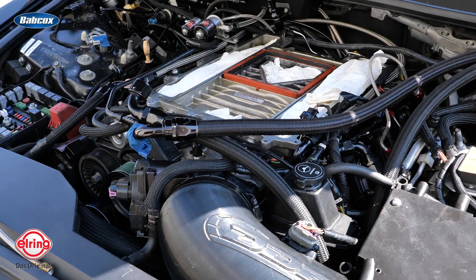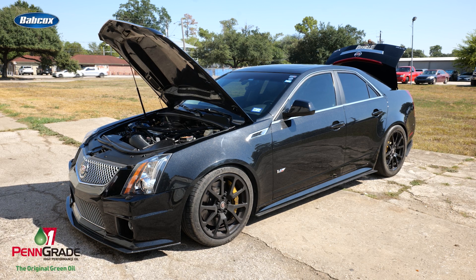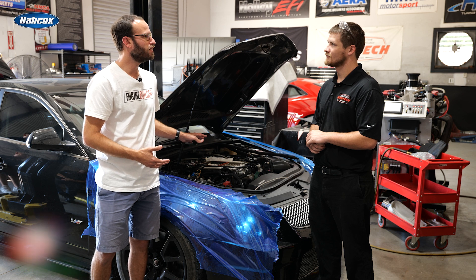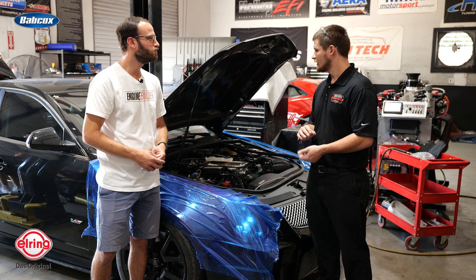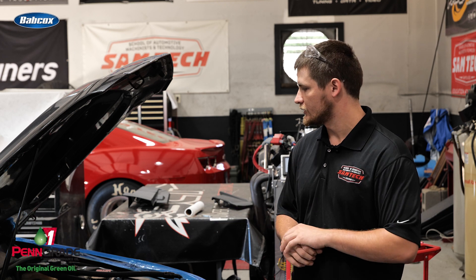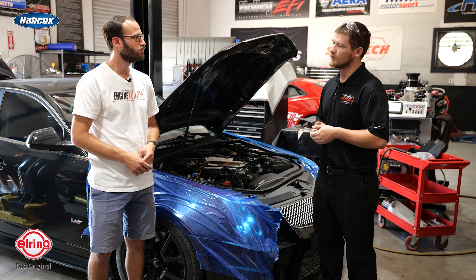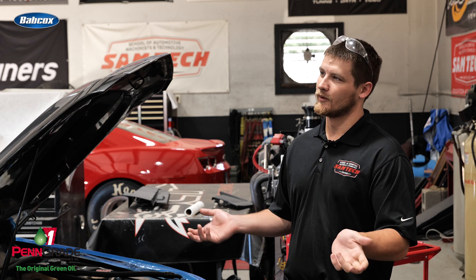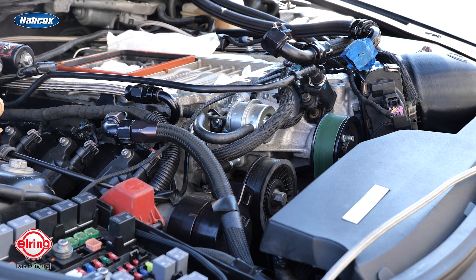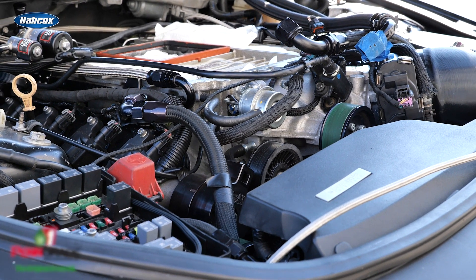This engine is set up for mile racing very shortly, trying to hit some top speeds in the mile. So you guys are also getting into some tuning work on it. Once we got the engine all together, we ran it on the engine dyno and put it in the chassis, started driving it on our chassis dyno here. It turns out we want a little bit more with it. For the mile, since we're going to be holding it wide open for a long duration, we actually wanted to put some extra cooling measures in there. So we ended up getting a ProMeth kit for putting injectors up in the hat of the blower to cool it off, to keep everything manageable along with having a little bit more power and a bigger tuning window.